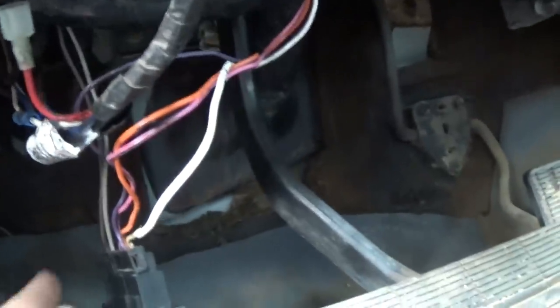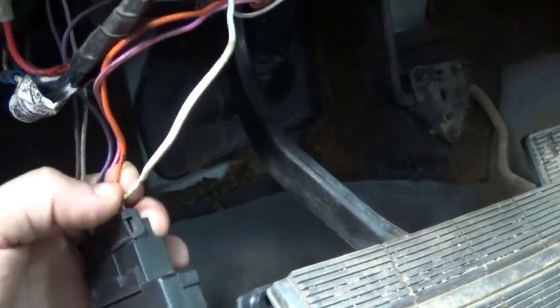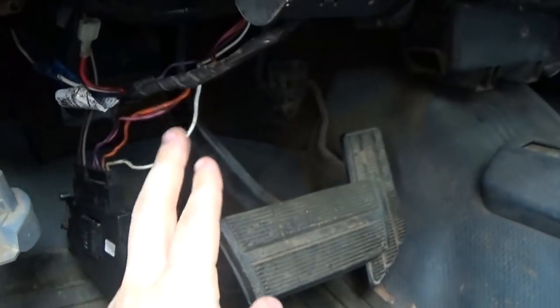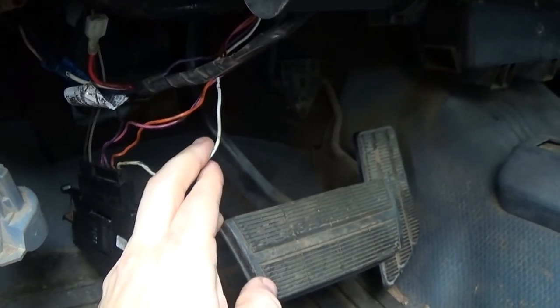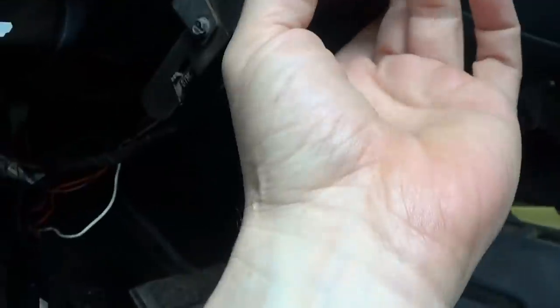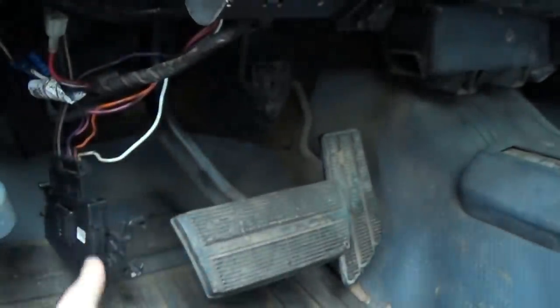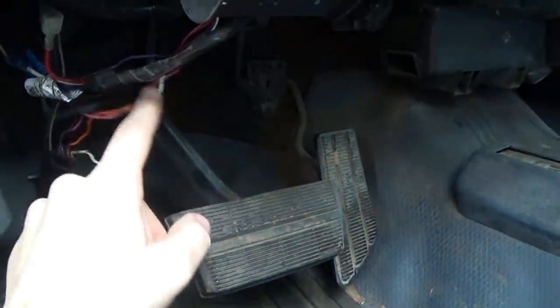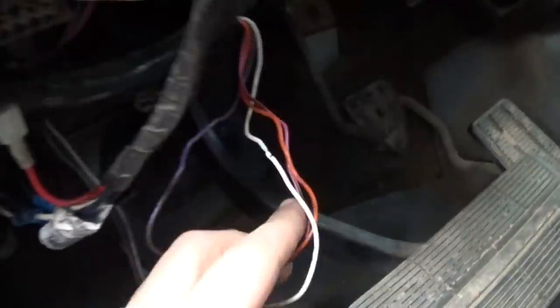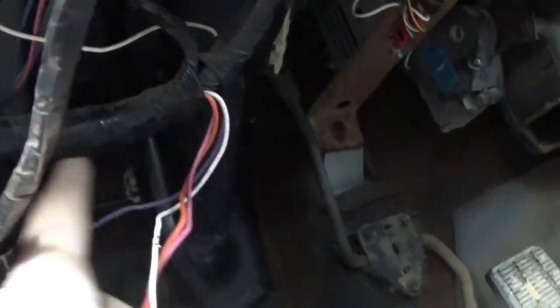through it. But it does not, so I can just real quick maybe supply power to that and see if we can get our seatbelt warning beep to come on. We found out last time as well that we could get that to come on by sending power into the brake wire through this thing by manually doing that. And did that, I held the brake, completing the circuit through the switch, putting power to that orange wire where it's supposed to be, and it kind of made the beep work. And I think wherever this orange wire is going, it's going to be where the problem is. Wherever we don't have a connection.